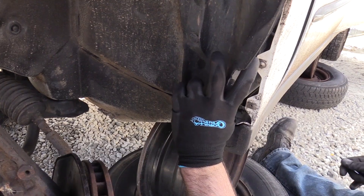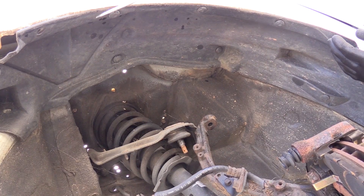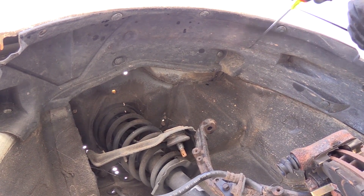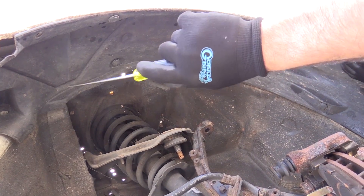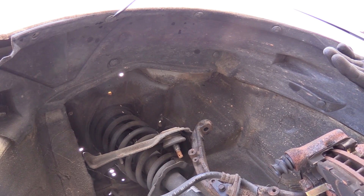Normally you have to remove a fourth one, but in this case we don't. Now you're going to need to remove the plastic clips that hold the fender liner to the fender. You can remove these four here around the outside. You can also remove the other clips on the inner fender liner — that's purely your choice — but in order to get the fender off, all you need to remove is these outer ones.